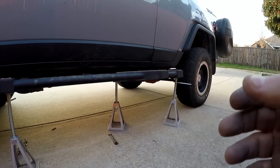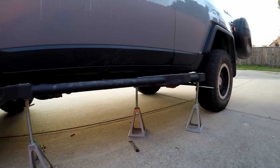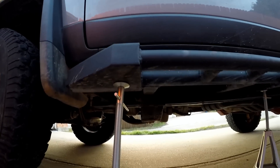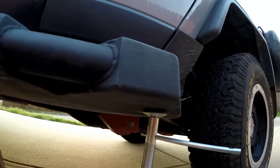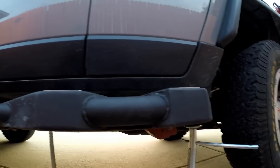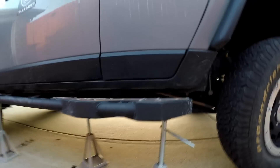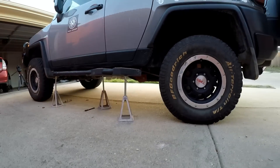Just wanted to show you what I did before I take the very last bolt off back there. I've got this jack stand up underneath this thick part here, I've still got that one down on the third arm, and I brought this one out here. Right now this thing is not bolted on — these jack stands are holding the whole weight of it and keeping it from coming down and crushing me. That's the whole setup.